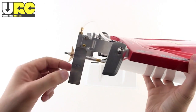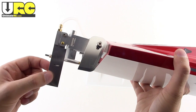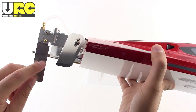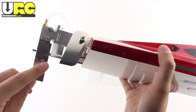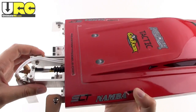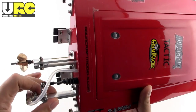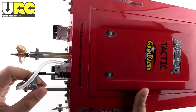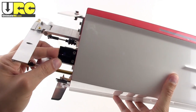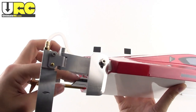Turning it around, you can see the water intake on the side of the rudder. There's actually a customer note they put out suggesting you use a small file to file out this inlet a little bit, make it a little bit longer so it'll actually capture more water. All the hardware back here is aluminum — these brackets are pretty thick material, machined out of angle material. It does have adjustable trim tabs; they are split down the middle and are carbon fiber pieces, with set screws for adjusting the angle on those.